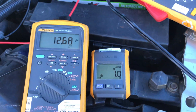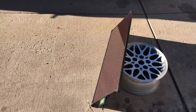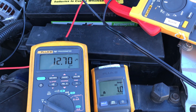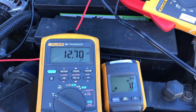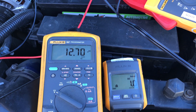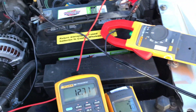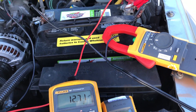I'm getting about one amp right now. It's in the sun about as direct as I'm ever going to get it — ideally angled, not just flat on a roof. I've got 12.64 volts and about one amp. What I can't say is whether the charge controller is limiting output because it sees the battery is already well charged. If I had a more dead battery with lower voltage, the behavior might be different. This is a well topped-off battery — I just drove around doing grocery shopping.